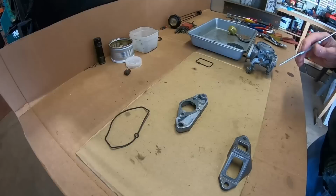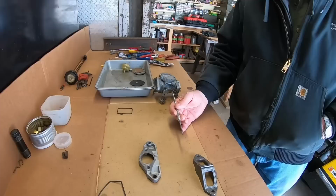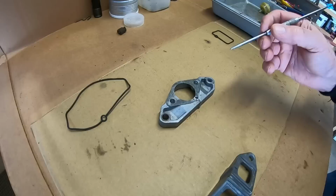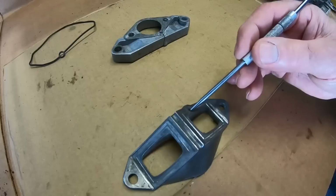I took the manifold off the engine. And that's what the carburetor attaches to, right? This is a smaller one, off a 399, definitely. Rotax is big, the 440 is bigger. But what I found is this piece goes to the cylinders. And there's a pulse line that comes from off the bottom of the cylinder right here.